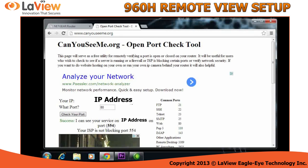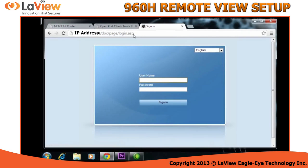If you see success on all three ports, now you can access your DVR from anywhere. You can copy this IP address. If you're using any computer, you can open Internet Explorer and type this IP address and that will get you into the interface of the DVR. Or if you're using your smartphone device, open the application, put in the IP address, and that will also get you into the DVR interface. Let's test if it was properly set up — I'll simply copy the IP and put it in my browser. If I get the username and password login of the DVR, you have successfully set up your DVR for remote view. Simply type the username and password and login.